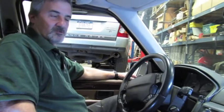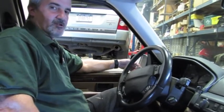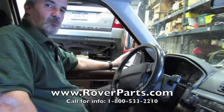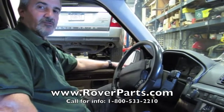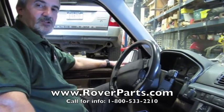The vehicle can lose the ability to hold a steady idle if you change the throttle position sensor, the idle air control motor, or sometimes even just changing the vehicle battery or getting a low battery voltage situation that throws the system out of whack. There are some basic procedures you can find online, but in a lot of cases that won't fix it. So when you're ready to fix the idle problem in your GEMS engine — whether it's a 96-99 Discovery 1, 96-99 Range Rover with GEMS, or even the 97 Defender.